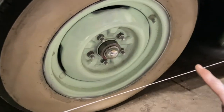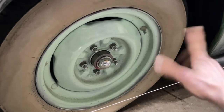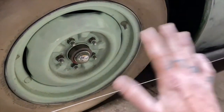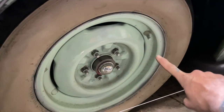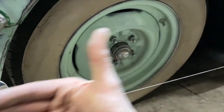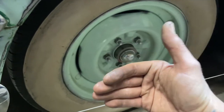That string is now running parallel to the rear drive line. If we measure up at the front and the rear measurement was six and a half on both sides, we know the string is running like a laser to the front. If we have seven inches here and seven inches on the other side, and the wheel is perfectly straight, then this wheel is going perfectly straight ahead — just like the rear wheel — and there's no problem.